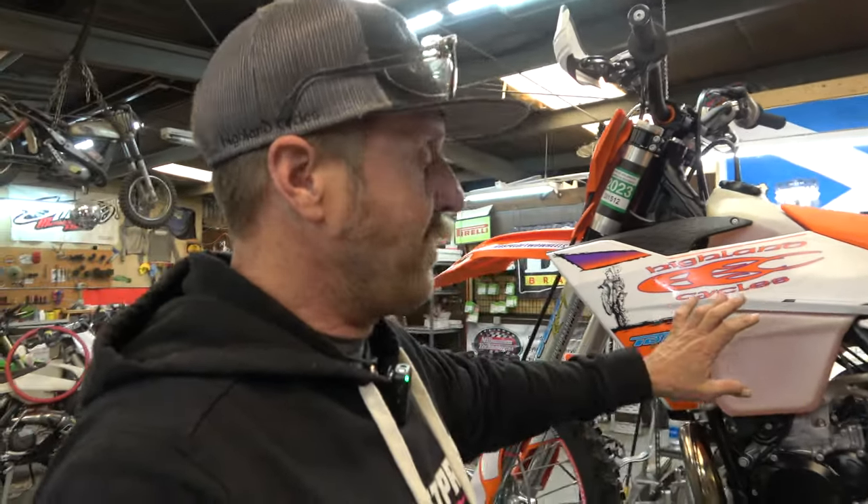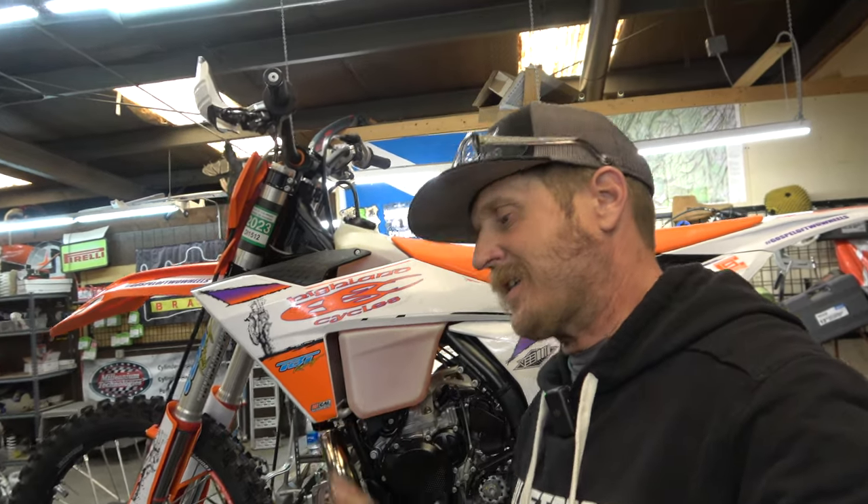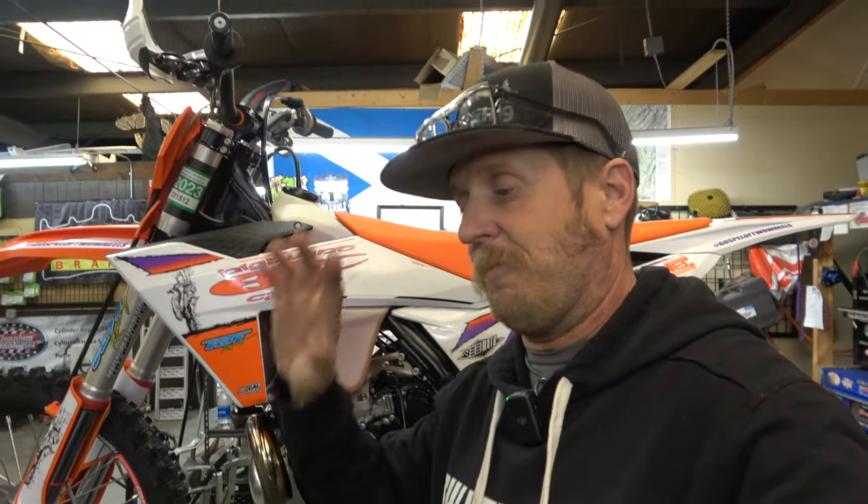Next I want to talk about RK Tech. The motor on this motorcycle is incredible — you honestly don't need to do anything to it to go racing. But as a guy who likes horsepower and lives at 6,000 feet, I wanted more. We lose about 20 to nearly 30 percent power at altitude. Kelsey built me a couple different domes — we've got one in there and another to test — and the bike is amazing right now. It feels like a sea-level 300 but still has a ton of scream on top. We will eventually be offering that head as something like the Highland Cycles head.